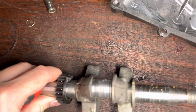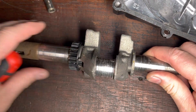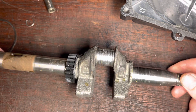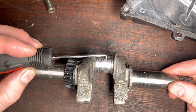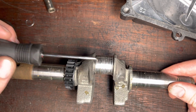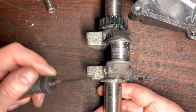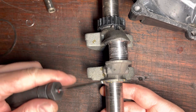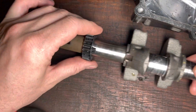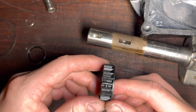And then of course we have the crankshaft. This is just starting to flash a bit because I've just washed it — I should probably give it a spray with some oil, but honestly the chances of me ever using this are basically zero. I'll just chuck it in a vapor rust. The main journal of the crankshaft has got a lot of transfer — that would clean up, I'm sure of it. And then this upper side has got a lot of transfer too, which is not that surprising as it won't get as much lubrication. Whereas the lower side will. This cam gear looks absolutely fine.